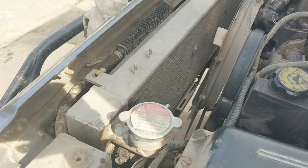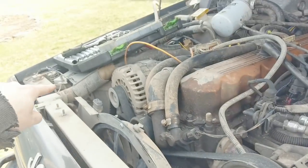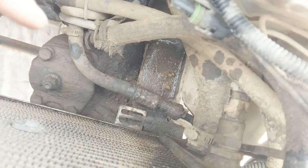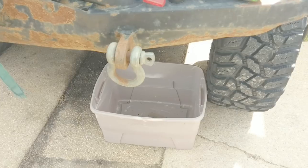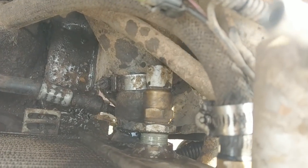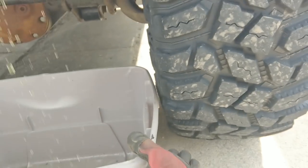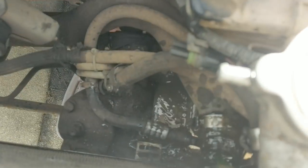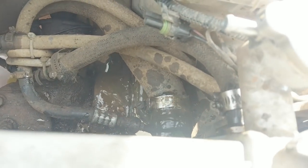You'll have these bolts if your header panel is together or not. I know this is the only stud remaining, so I just got to take these bolts off, pull it, and then it'll come off. So now that little member thingy's off, maybe we can get a look at the radiator. I forgot how wide this thing was — upper rad hose, lower rad hose, both trans cooler lines. Oh, kill me. I hate those trans cooler lines so much. So now it's time for the drain. I can't get the lower rad hose off because my sensor's in the way, so pull this first and just try to catch as much coolant as you possibly can.